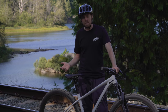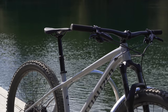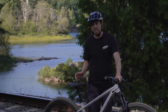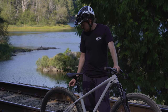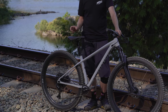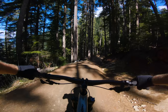For $1,675, you get a bike that is pretty darn fun to ride. It won't fall apart in the bike park and it's got some really good parts. The Specialized Fuse starts with an M4 aluminum frame. This year the reach has increased by 20 millimeters on all sizes — it's a little bit longer, lower, and slacker. The head tube angle is 66.5 degrees and the chainstays are adjustable, going from 420 millimeters all the way up to 435, giving you 15 millimeters of adjustability.